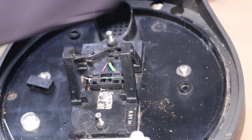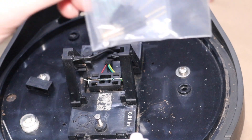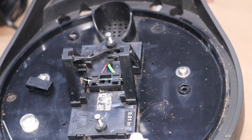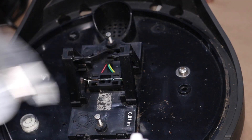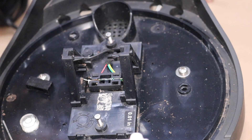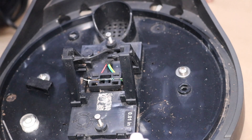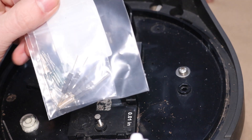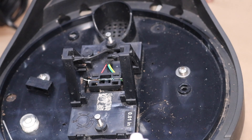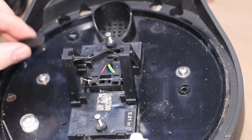This is pretty simple — it's just soldered on here. I purchased some replacement reed switches from Amazon. The way I determined what size reed switch I needed, I simply took my caliper and measured the width of the glass filament, matched that in my search online, and was able to locate a bunch of replacement reed switches. Some of these do have a black protective cover on them.